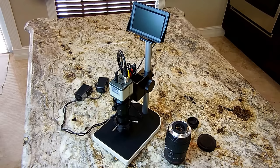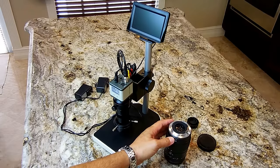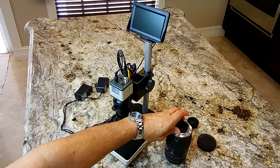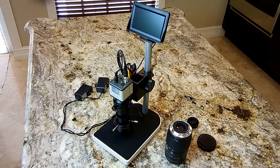There was a problem with the lens autofocus manual switch right here. What happened was it was getting jammed — it was not engaging the internal switch and the spring-loaded mechanism at the same time. So when my friend did the repair he had to partially disassemble it, and this top piece was flopping around and it ended up having the ribbon cable separate from the circuit board.